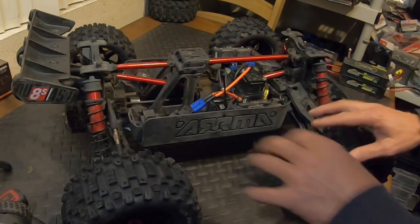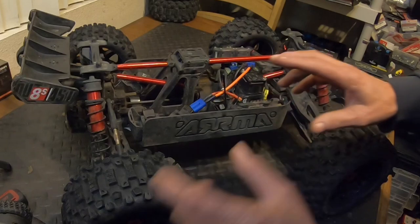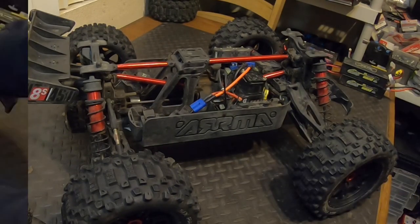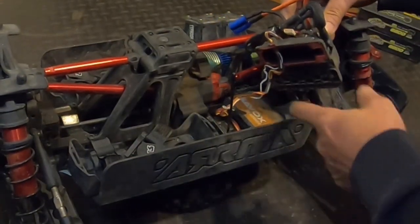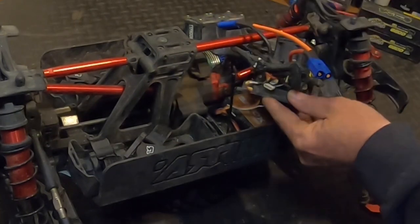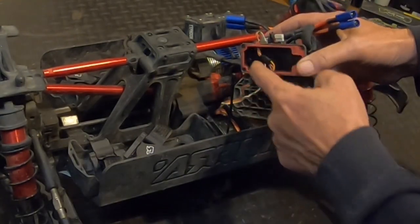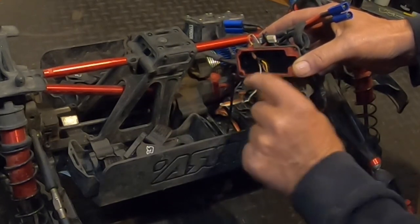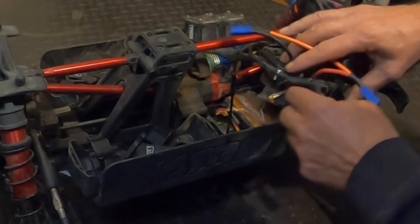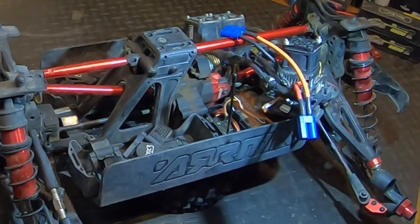Before I do any of that, I'm going to pop these wheels off. The way you have to calibrate the receiver is sketchy — the throttle doesn't work during that process, but if you don't do it right the RC could take off. You can see my receiver wires are patched here and here because popping this off so many times has pinched the wires in this small box. I've had to repair this harness a couple of times — but the harness isn't causing the issue, it's the receiver itself.